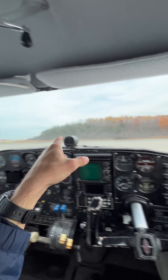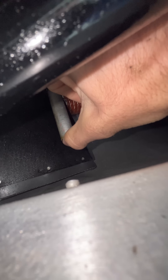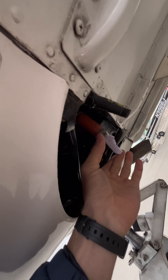Luckily, as with most things in aviation, there's always a backup. In this case, most, but not all manufacturers have drilled a secondary exit hole a little higher up on the pipe, just in case the bottom one gets clogged. But no matter what, this is why it's always important to check this little tiny tube for icing on your pre-flight and to remove any if you see it.